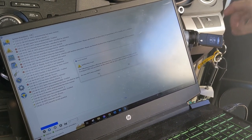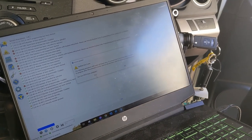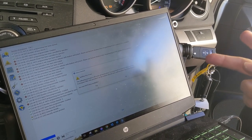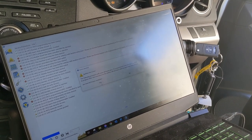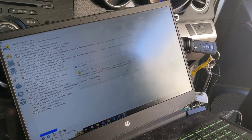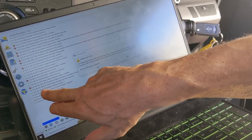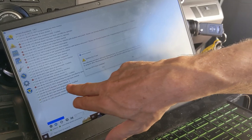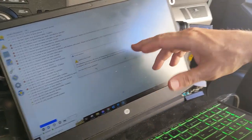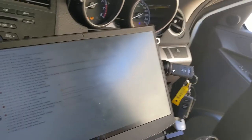It's saying the following procedure is going to erase all known keys and it's important to have two keys available. I should have mentioned earlier: when you go to the wrecker, don't just get a barrel with one key — you have to have two keys. If you get sold one with one key, take it to a locksmith and get a second key made with the correct blade shape; as long as it has a transponder in it you'll be fine. Notice here when it was interrogating the body control module, it said 'number of keys stored is two' — it's about to erase them down to zero. It's asking do I have two PATs keys available — I do, so I say yes.